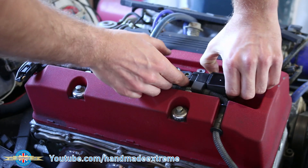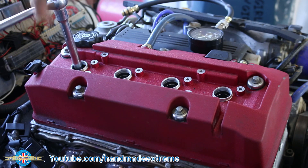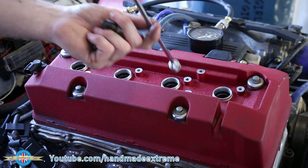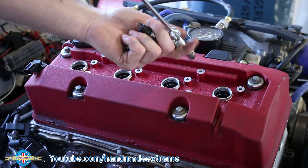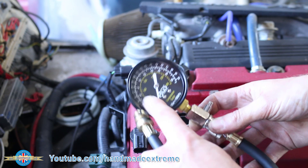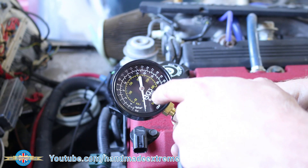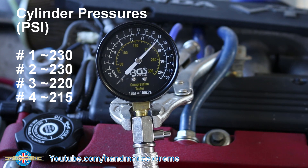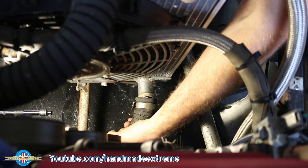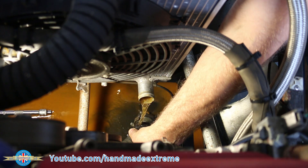This tests that you haven't got a leak between the cylinders or a leak between the cylinder and the water jacket. This is a compression tester — this end gets screwed into the spark plug hole, and then when we crank the engine the gauge records the maximum pressure in the cylinder. We do it for all four cylinders and they should all be about the same. Number four does seem a little low.